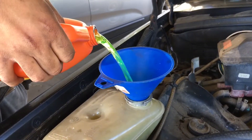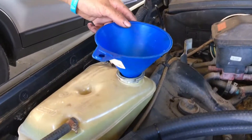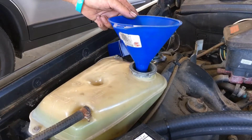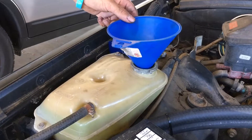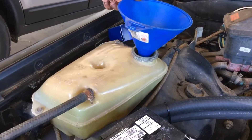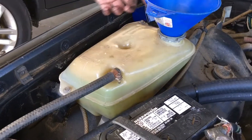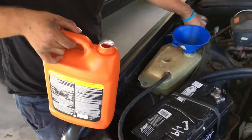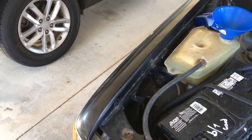Don't think just when it fills up you're good and dandy — we overfilled it. That's fine, just barely loosen the drain plug and let it drain out, then tighten it back up. It is going to go down when we turn it on, so just leave it like that. It only takes a jug and a half, so if you drain it again, there you go.